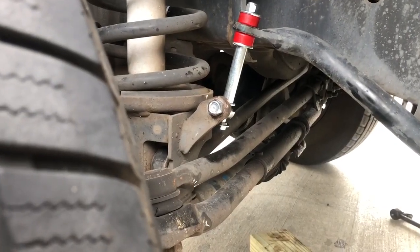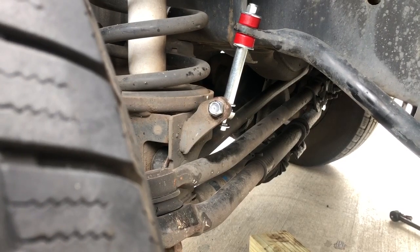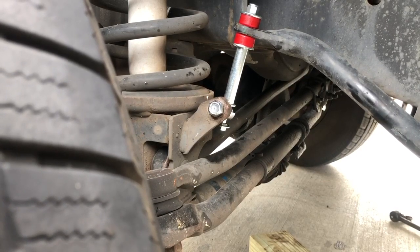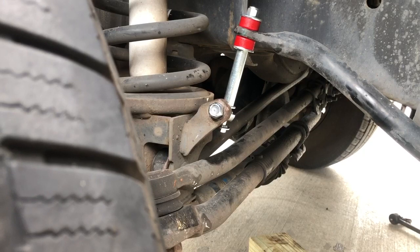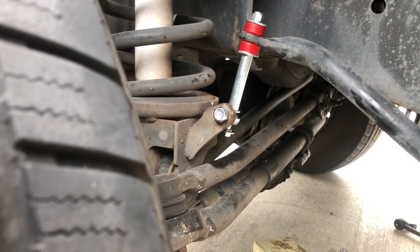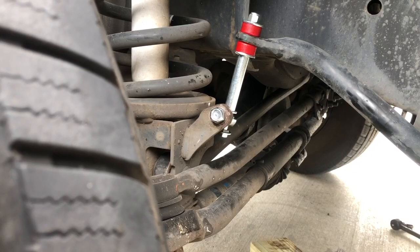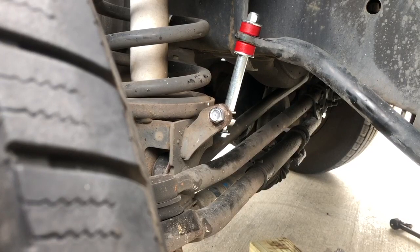On this side, just make sure that when you're tightening up the top nut, the bottom is probably going to be spinning. So you'll need to use pliers to hold the bottom bolt in place so you can securely get it on. Once it gets to a certain tightness, you don't have to hold it all the way. The instructions say — and basically universally everybody agrees — once you start to see the rubber bushings start to flex a little bit, that's when you stop. You really don't want to go too far past that, because if you go too far, it loosens up all the setting you've put into it. Get it to where you start to see the bushings flex a little bit, then let go and you'll be set.